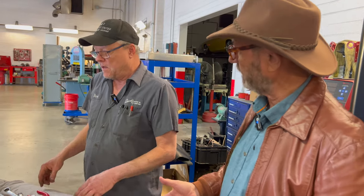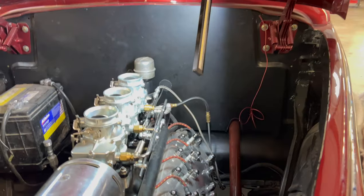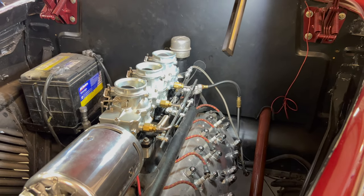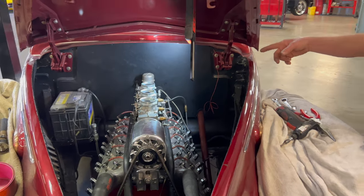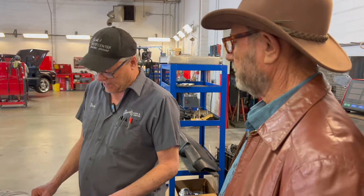Does it do it every time? Because it's taking it out of here. Okay. And you're adding all the time, so it's creating this vacuum all the time with the fuel pump, and when it does that, it'll create bubbles. Oh, so it'll keep doing it. Yeah. It's actually a sign of a good fuel pump, because that glass bowl is staying very full. If you get one that's on the ragged edge, it'll be about halfway level, and then you'll see a whole lot of bubbles, and that tells you it's working really hard but not keeping up, and it's starving the engine for gas.